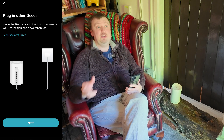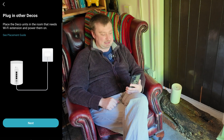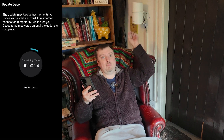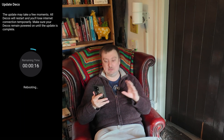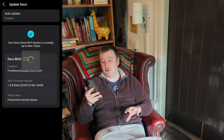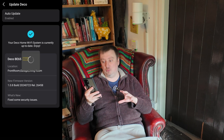Now it's time to plug in the other Deco nodes. I'm setting them up over wired backhaul. You actually have the choice of wired, wireless, or a combination of both backhaul — an interesting option with this system. I've got the other two nodes plugged in with just power cables nearby. After waiting for all LEDs to pulse blue, the nodes are all set up. There was a firmware update which I've done manually. All three nodes are connected over wired backhaul, including one in the garage, which is an external building.